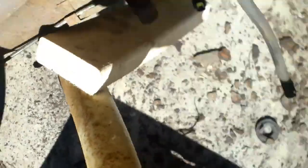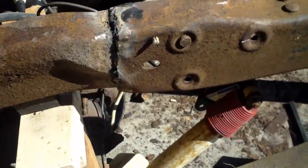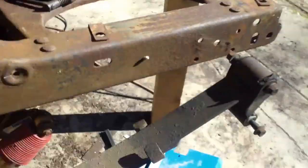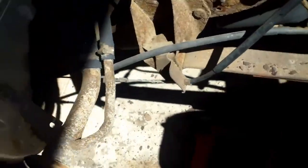We found a stress fracture — a little stress crack right in there. What we decided to do, instead of holding it frame to frame and welding it, we overlapped it a little bit so that way it would be more strong and we wouldn't have to worry about it. Other than that, it's coming out good. It's going to be nice and strong when we're done.